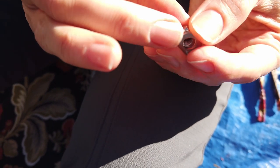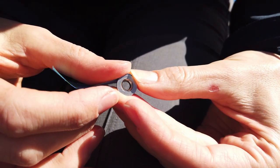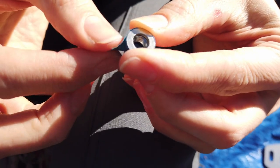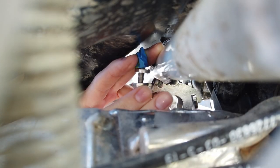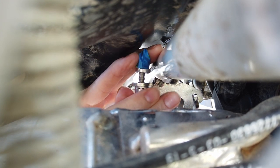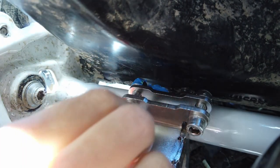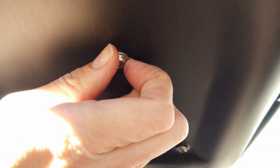And here's the second trick. Placing a washer and a nut separately on top of the rear bracket is almost impossible. So I used a piece of masking tape — and I'm sure that some duct tape would also work — to connect them together. This way it's much easier to slide them into place and keep them there. Take one of these nut-washer pairs, a bolt and another washer, slide the bolt through the bracket holes and screw it to the nut, only as far as it goes by hand. Once this is done, remove the tape. Connect the other bolt the same way — don't forget about the tape. Now you can add the last three screws: two in the middle of the skid plate and the last one in the center of the rear.